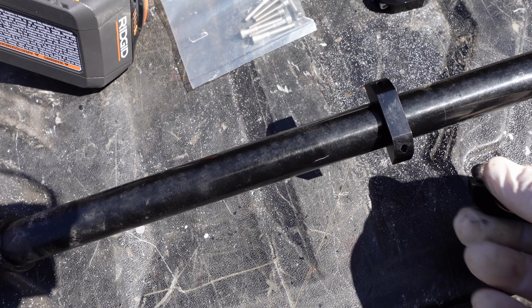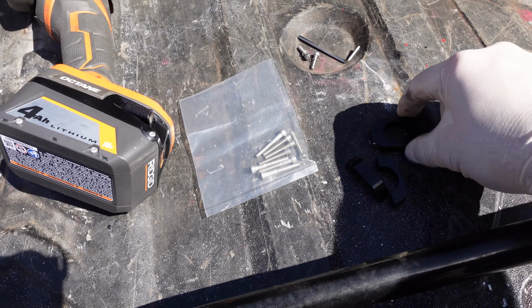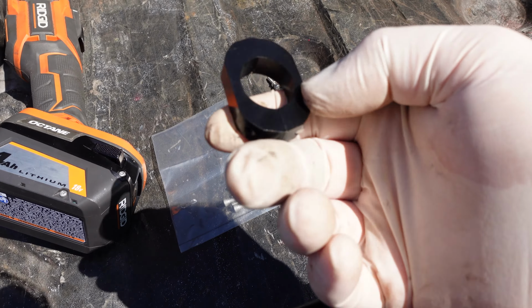So when I purchased it, it said 24 millimeter sway bar for the rear. I purchased the 23-24 size from 1320 Performance, and these are what they call lateral locks, and it just goes over the bar and you bolt it down. The only problem is it seems a little too small, and you'll see when I bolt it on. It feels like I'm missing a millimeter or two, but it's not an issue because I got longer bolts. Once you bolt it on, it's not going anywhere. I'll put blue Loctite on it, and I'm gonna get to grinding right now.